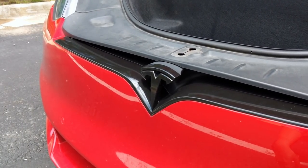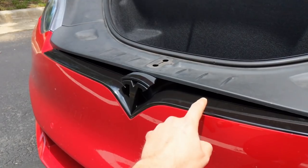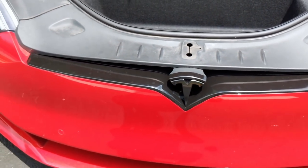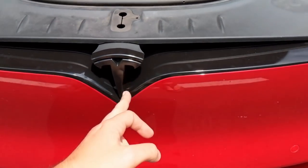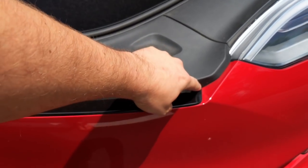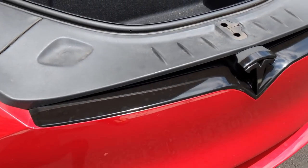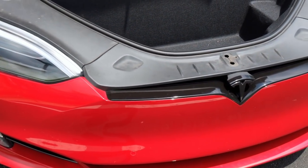My fiancée actually did that piece and did a really good job. Now this bottom piece — once the T is gone, it's a lot easier to do. I did it all in one piece, but in retrospect I may have done it in two pieces and seamed it in the middle. The biggest key is to take one big piece of wrap, the full length. It's only about three inches deep. Stick it in there, get the vinyl down in the center, and start in the center working your way out. Once the T piece is off, you have better access to the corner so you can trim nicely. Take your knife and slit right along the edge — it gives a really nice clean cut.